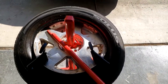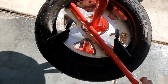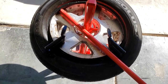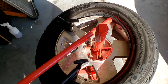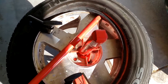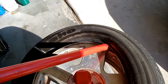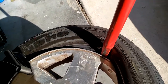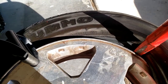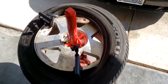Then what we're going to do is get this crappy tire iron that came with it, slide it in, and slowly work it around. As we do that, we're going to move our helping hands a little bit closer so it remains below the alloy rim. Just poke it in this way, nice and near the edge, and just push it in. Then just lift — just like that. You see the tire pops down a bit, then we get our helper and just scoot the helper along. We've just scooted the helper along and we're going to keep repeating that so it's seated on the rim.